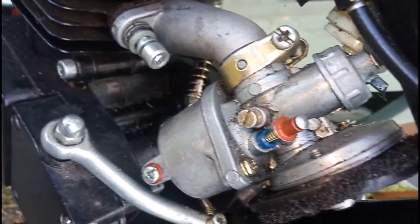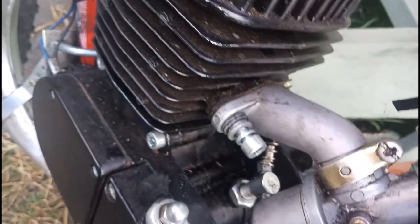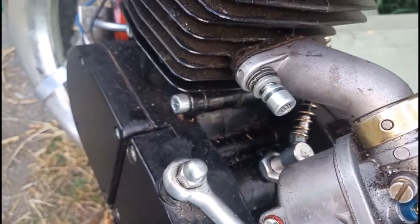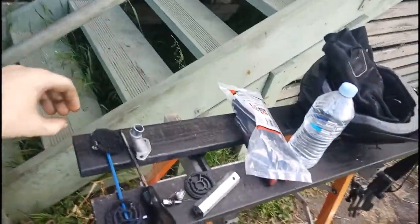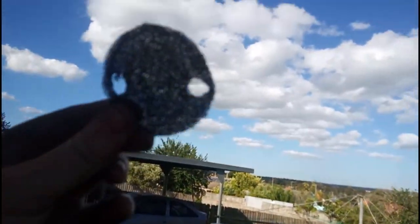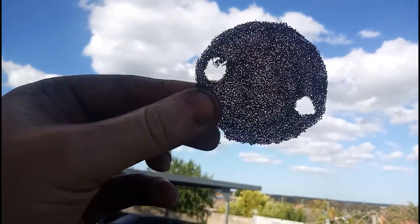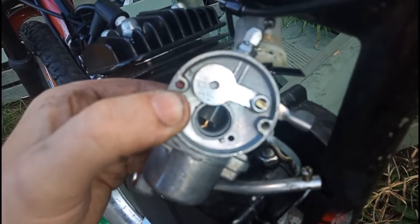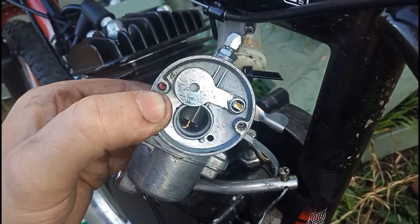But yeah, I've used cardboard gaskets on the intake more than once, and while it's looking a bit worse for wear, I may have to cut a new one, but that's held up really, really well, and it has not caused a single air leak. All right. So we've got our filter here, which is squished, but surprisingly not covered in crap. And to confirm that, look down there. Now, I have not wiped that clean, and that is immaculate in there.